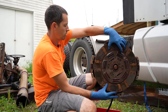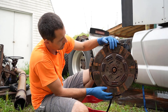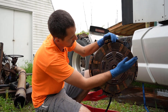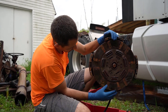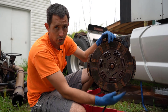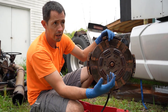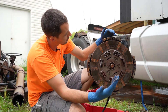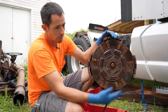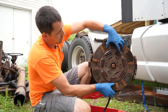We'll kind of go down through the line here. You got two discs in here. And what wears out — there's these plates — they're like a metallic or ceramic material, depending on the type of clutch. But this is what wears out normally; this is a wear item on your clutch. These pads wear out. It's almost like a brake pad in a car — same concept. So these wear down, and once they wear down, that's when you get metal on metal and your clutch doesn't work anymore, or it slips because it's metal on metal.